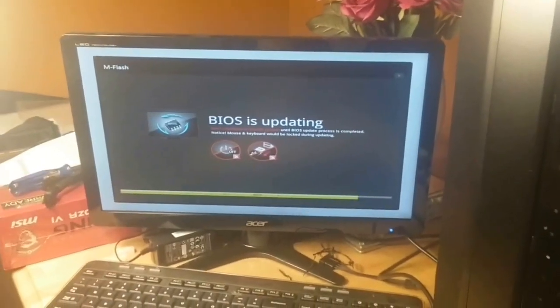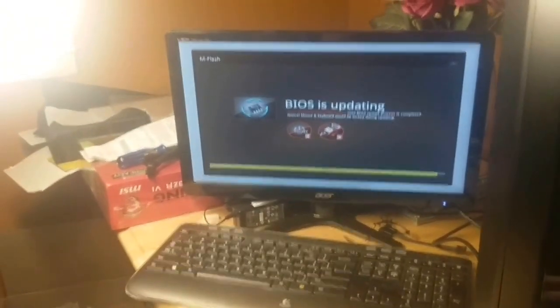It's at 60%... we're just about finishing — we paused the video there for a second. We should be updating to the most recent version of BIOS — this is actually September 22nd, 2016, which is much more recent than the one we had before. I think the one we had before was compatible but really not the right one for the gaming pro carbon. I'm very thankful that MSI prevented us from killing our system. The DRAM debug LED came on, then went off. Now the VGA is on — usually the VGA will come on just before it starts outputting. There we go, excellent.